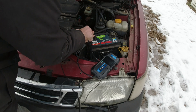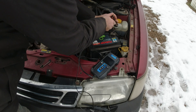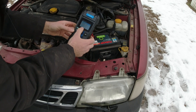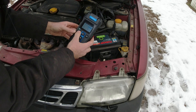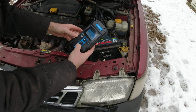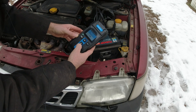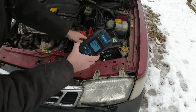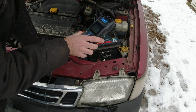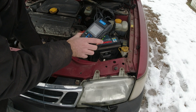Let's connect up the positive clamp. There's a little bit of oxidation. These clamps are really nice — I wish the clamps on my battery charger were that good. 12.5 volts. Battery test, regular flooded — it remembers EN from the last test, that's really nice. Passed it — 540. I'm not expecting this thing to be great just by looking at it; that battery is probably really old. But you never know. 54% health, 92% charge. Maybe it's just good enough for the Saab. Now I want to go back and do the cranking test.